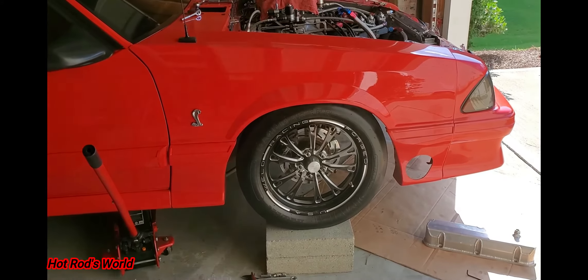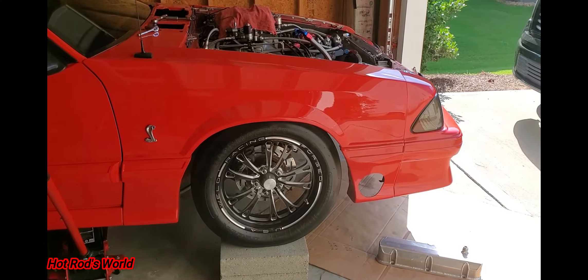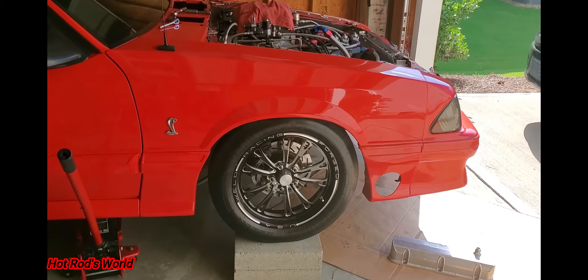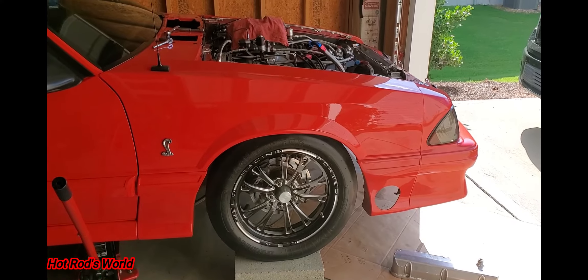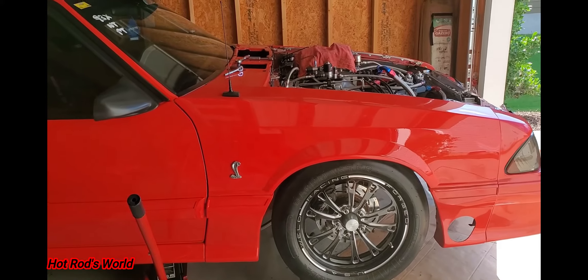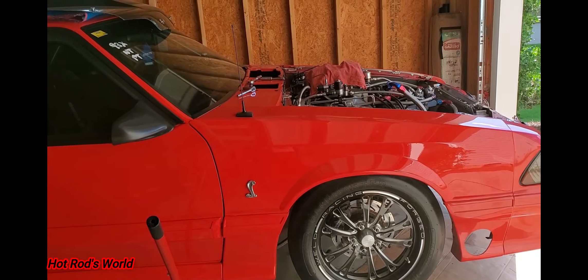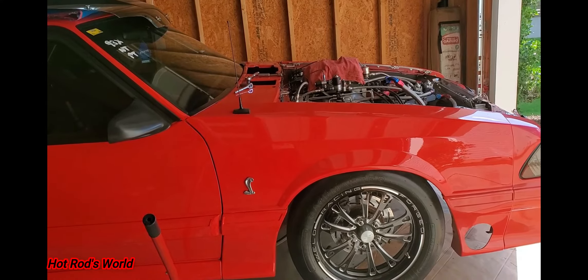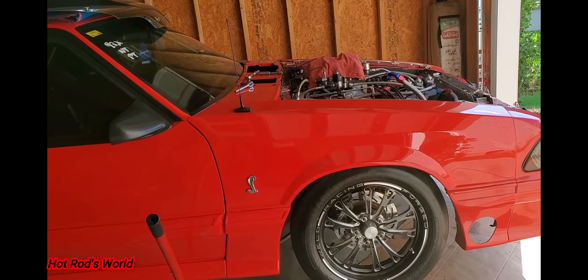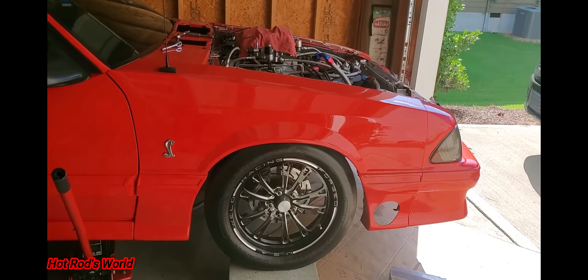That's good and bad — I still got some wiggle room and I can lift the front of the car up an inch or two to get more ground clearance. As long as it isn't dragging the ground I've got three or four inches under it. When the car leaves the line it's going to lift up probably two or three inches, so it's really only on deceleration I have to worry about it hitting. Just wanted to give you an update on where I'm at.